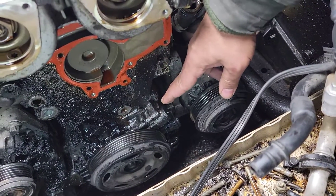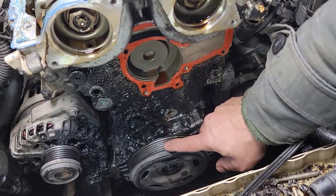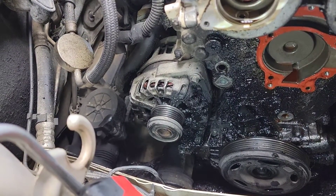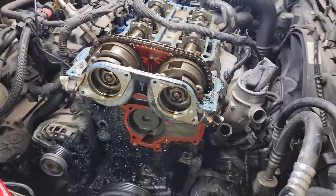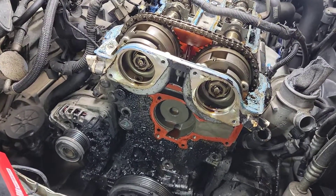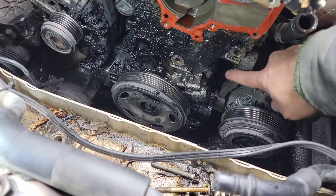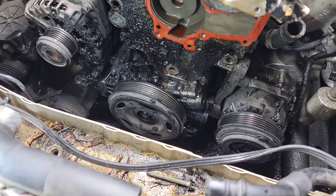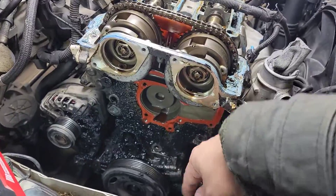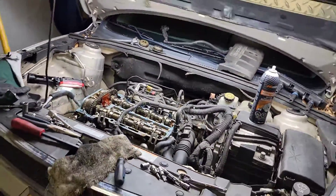Once detached from the timing cover, we'll take out the crank bolt and the crank pulley. I'm not sure about the alternator — I don't know if you need to take that out; we'll find out. But next video, we're gonna put this on TDC. I've got special tools to lock the cams down so they won't move, and there's a pin that goes in the surface hole on the side of the block to lock the crank so it won't spin. When those two are locked, we take out the crank bolt and crank pulley. That's it guys — give me a thumbs up, like the video, see you on the next one.